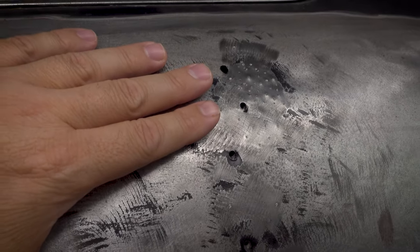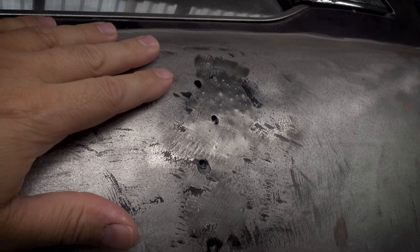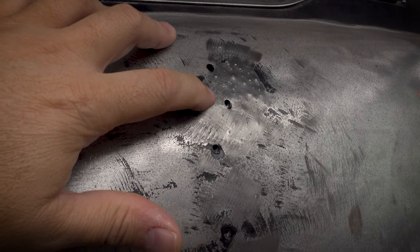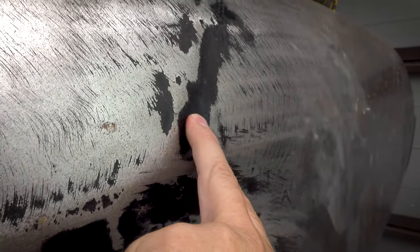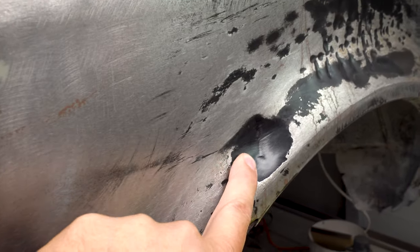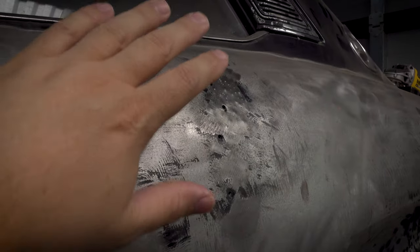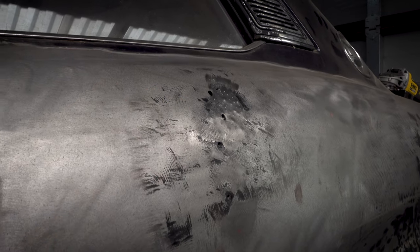And what I'm looking for is not that the dent will be gone. We're never gonna get this to a point where we file finish it and stuff like that. But if I can make sure the level of body filler in here is not more than say a millimeter to 2 millimeters, I'm comfortable with that as a repair rather than something like this. This one down here probably needs about 6 mil in it. And this one down here probably needs more than a centimeter at the moment. And yeah, that's not good. So I'm gonna keep going on this one, and then I'll show you where we're at before I throw the dolly on it.